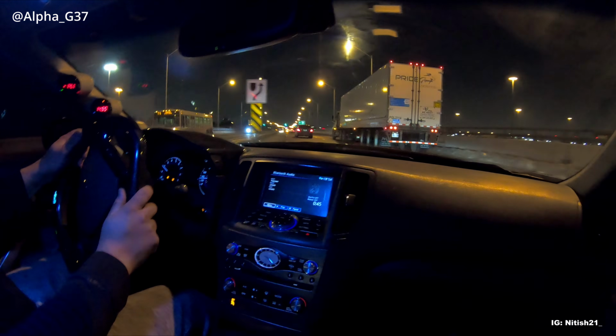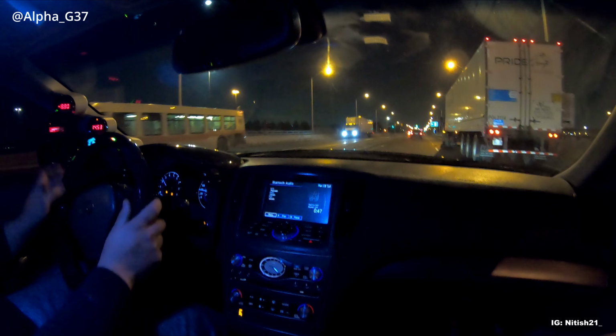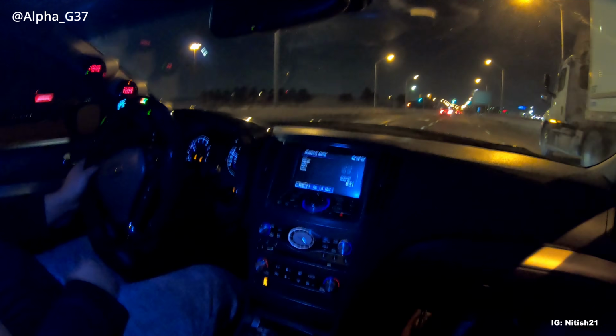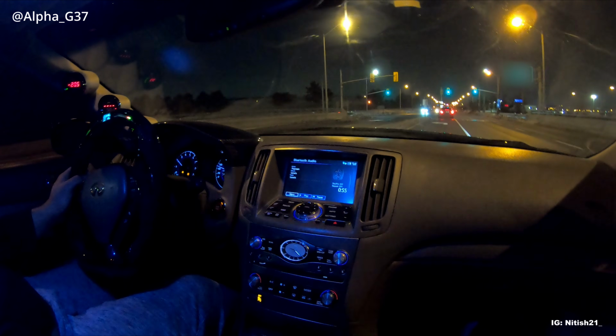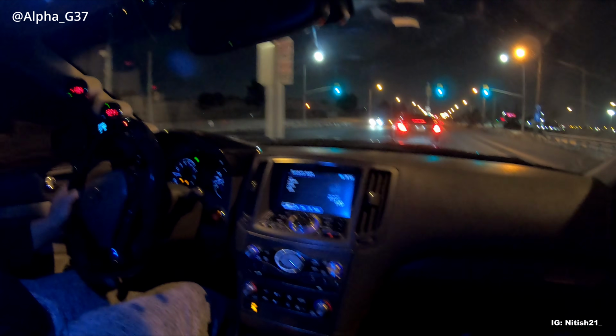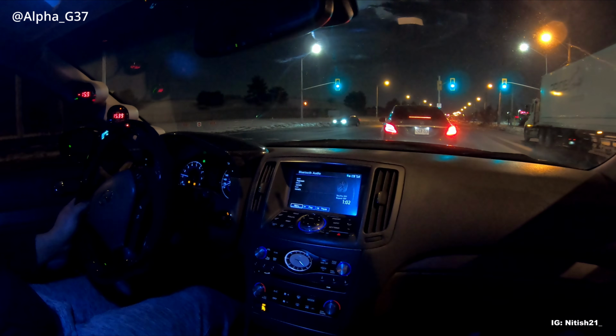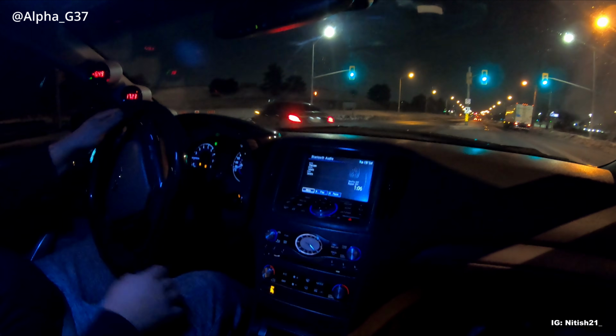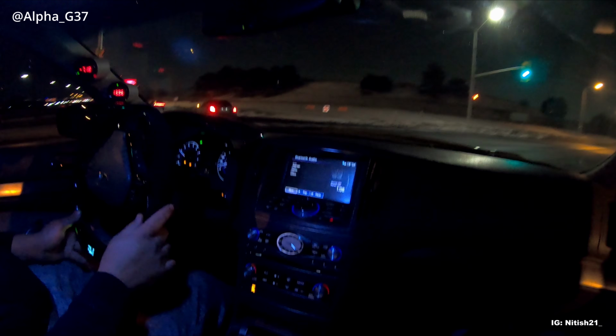Obviously not finished yet, guys. What you're hearing right now is literally just an open dump exhaust. It's just a downpipe right off of the turbo, and that's it. A 3-inch downpipe. So you still have to have the entire exhaust made. It's going to be made with dual Vibrant mufflers on it and an open dump cutout, so that way he can actually turn it on electronically and make it go from quiet to loud at any time he wants.